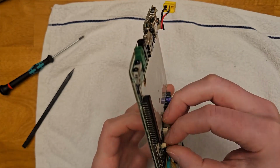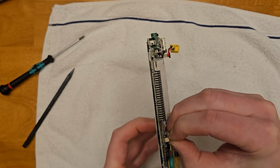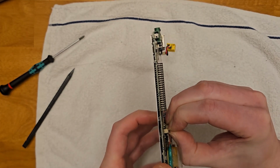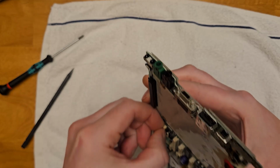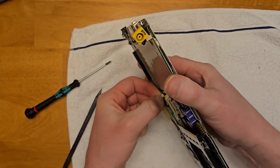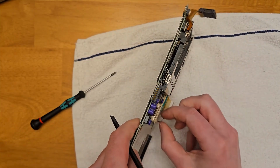It's a little tricky to get this connector out. It's super fine wires and a really tiny connector. I had to wiggle it back and forth a lot. But in the end, I don't actually see any signs of leakage onto the board doing damage, or even corrosion going on the wires. My guess is the batteries are leaking, but it's still all contained within the heat shrink. It's kind of outgassing, and that's what's discoloring the metal above and to the side of it.